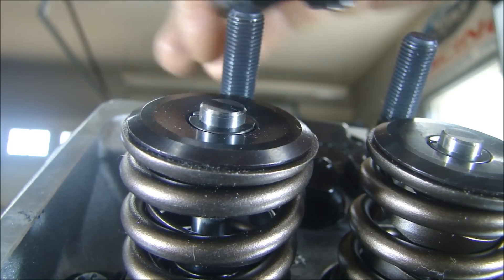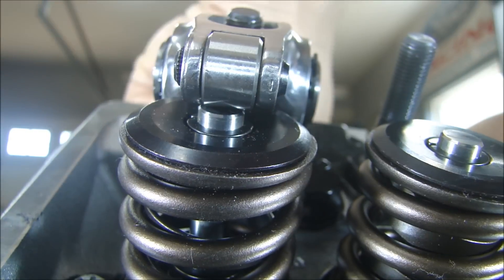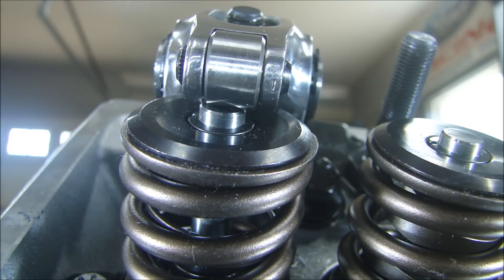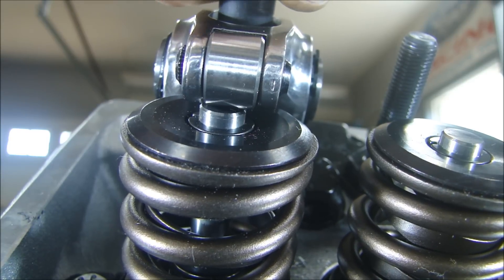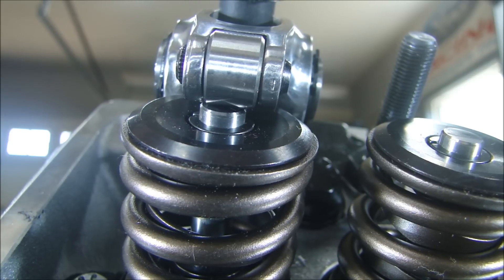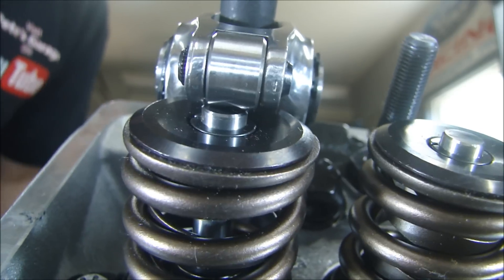Looks like the roller was right on the center — actually, go up just a teeny-weeny bit more. Now these should be standard sizes; I'm not going to have to have custom pushrods made. What we're trying to do is get really close — within 50 to 60 thousandths. It's not going to be hugely off; there are only so many sizes available. Put a half a turn on that, then turn it over again to make sure the rocker is sitting right in the valve.